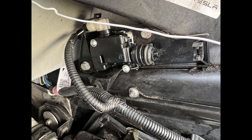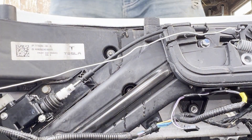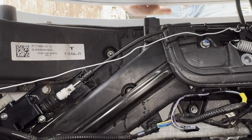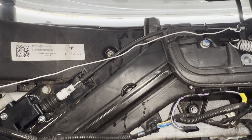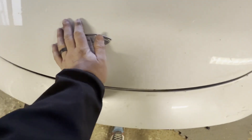I made an emergency release by running a wire through — I believe Tesla omitted this for security reasons, but there's a little cutaway in the housing suggesting they considered it. Pulling on the wire operates the latch in case of an emergency. I connected everything back up, closed the lid, then operated the release from inside the car to confirm the motor works. I also verified the manual emergency release works and put a small loop in the end of the wire to make it easier to pull.